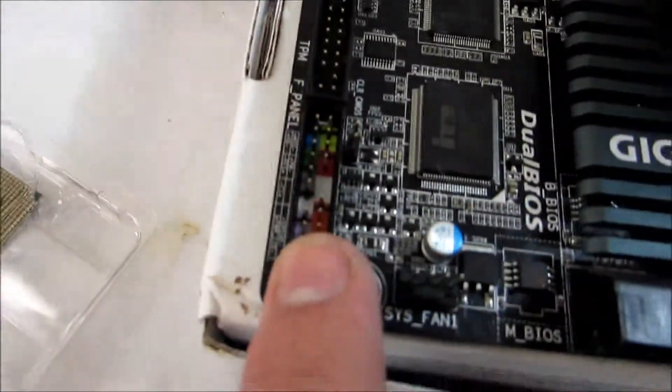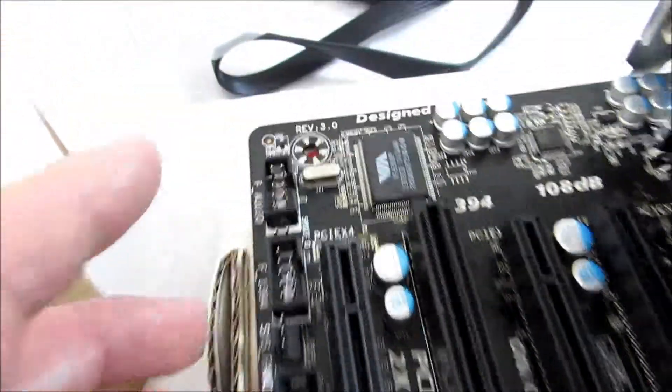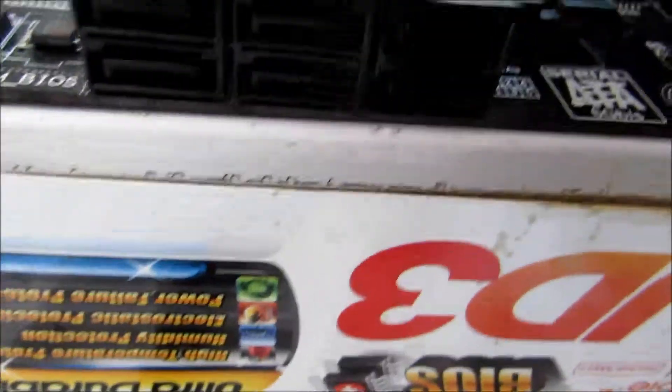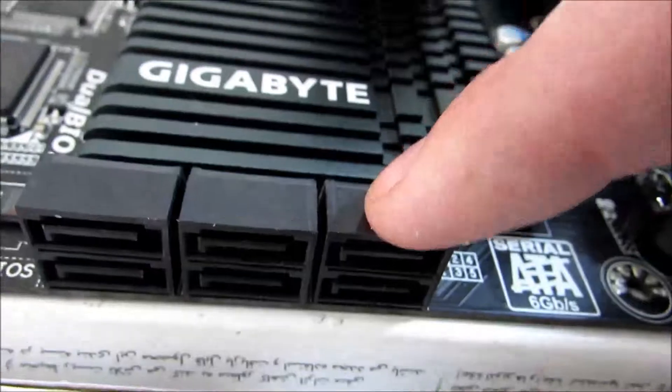You would also still have to hook up your front panel connections, which is your reset switch and your power switch. And you would have to hook up your USB hubs to be able to run USB, and also for your HD audio. Then, if you ran hard drives — which you pretty much have to for an operating system — you would run those into the SATA ports. There are 6 SATA ports. Usually the ones on the right are run by the onboard controller and the ones on the left by the motherboard's controller. I would always recommend using the ones on the right, and with those you would use your provided SATA cables.